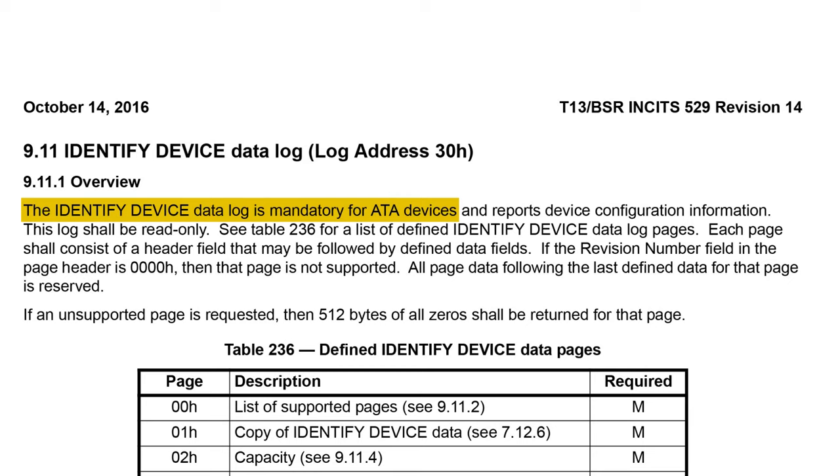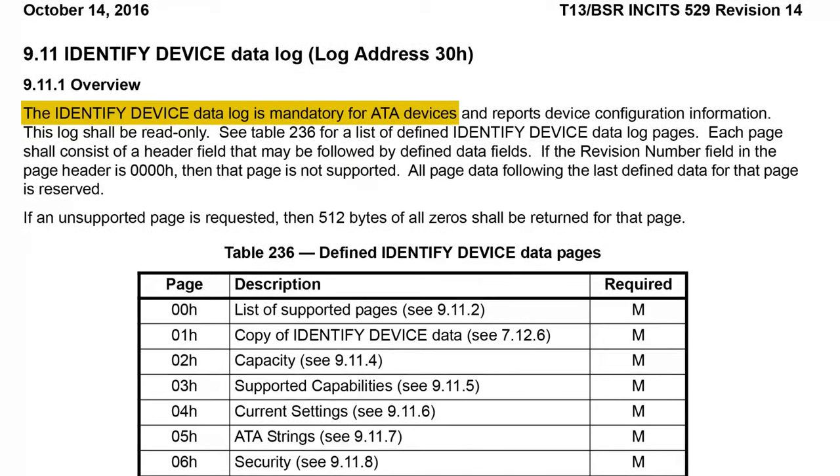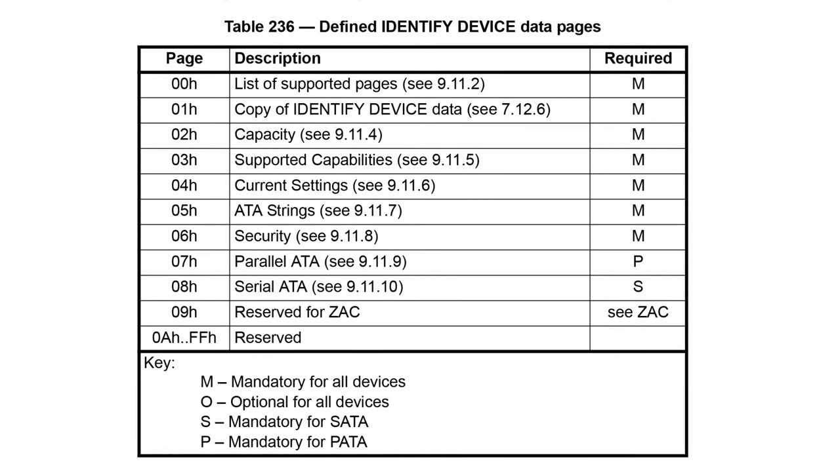So when Mr. Jared Land states their SSDs have their identification code — although they are not code, they are a log — he is probably playing with words so that later, if asked, he can say "I was right, every ATA device must have an identified device data log, so does ours, I'm fundamentally right." But as you can see, this is not exclusive to RED's SSD devices. The identified device log is mandatory by ATA. Furthermore, reporting correct capacity is also mandatory for all devices — marked with key M. So when the device identifies itself and reports its correct capacity on its power-up sequence, the host would have to be programmed to convert that correct report into false information displayed to customers. This is not natural behavior.